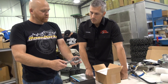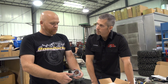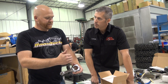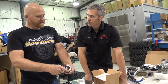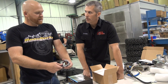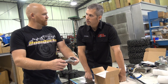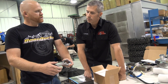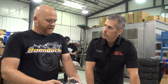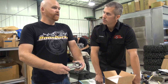It's a really strong way to build a rod, and when you look at it I thought 'high performance' — but you don't have to look into it very far before you find out that the reason they employ this method is usually because they're using a less expensive material. It's also a faster way and removes one machining process. The material the rod is made out of is obviously brittle so that it'll crack. The problem is it ends up really big and heavy at the big end, and it's a material prone to cracking, so under extra stress from a turbo or high horsepower, you run a really good risk of breaking a rod.